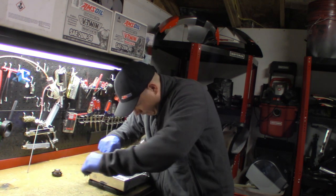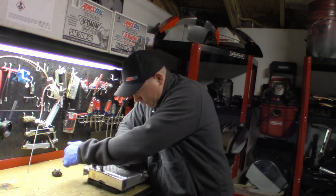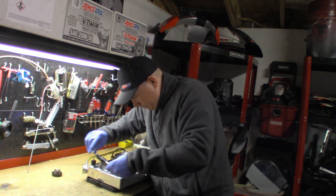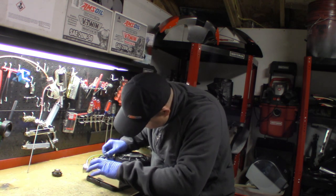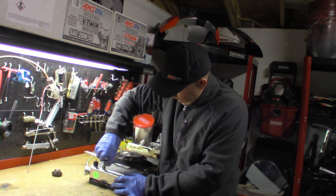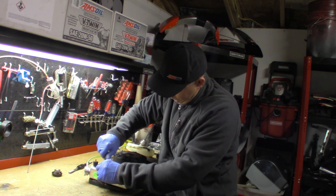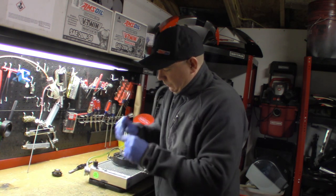So haven't had any issues with this so far, so the four-wheeler is running, no leaks or anything. The main issue with the leaks was, if you watched my silicone hose upgrade video, that when I reinstalled the new thermostat, I wasn't for sure if that was going to leak. But we're so far into it, I figured go ahead and replace the radiator hoses, the radiator fluid, the thermostat, and then we're probably going to upgrade down the road the fan and the water pump. You can put a bigger water pump propeller in there, and it'll cool it more efficiently as well.